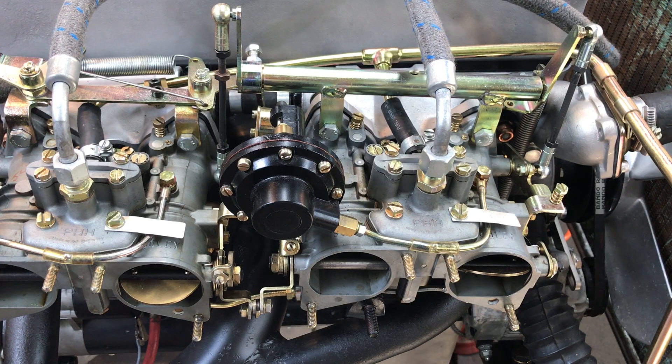So that's what I think the noise is that I heard on your video — a vacuum leak. A vacuum leak can manifest itself in many different ways, one of which is making a strange squealing or high-pitched whistle sound. I hope this helps, Ivan — let me know if this diagnostics helps and if you figure out what the problem is. Thanks and good luck!